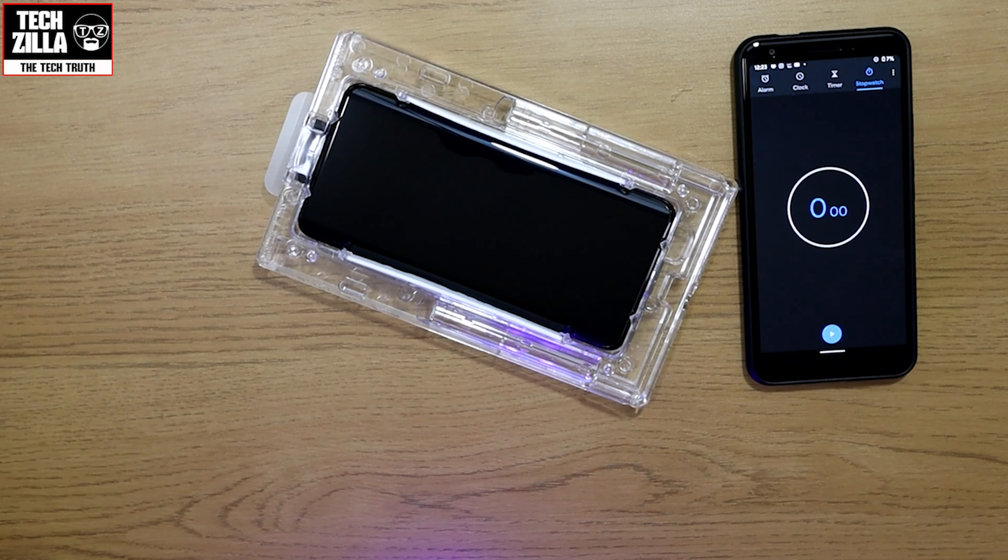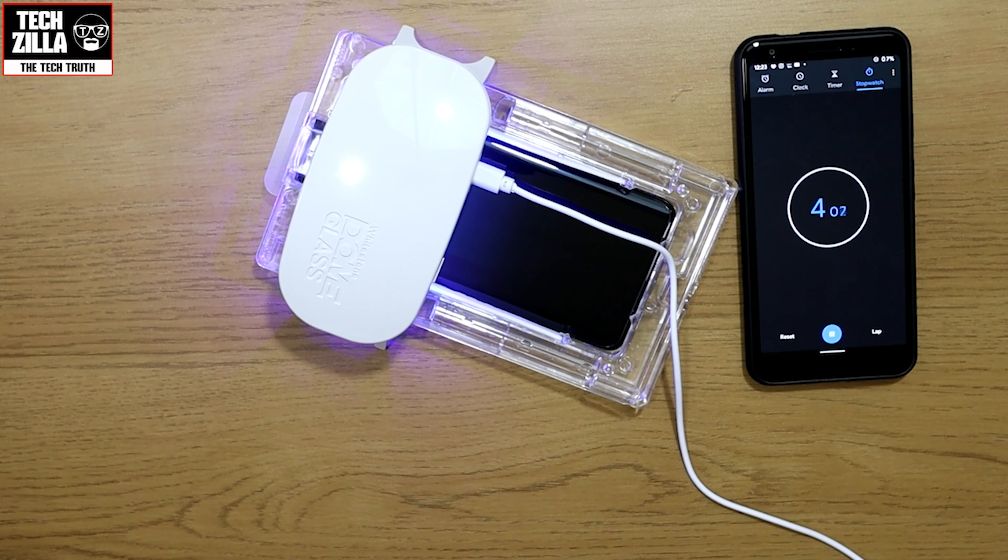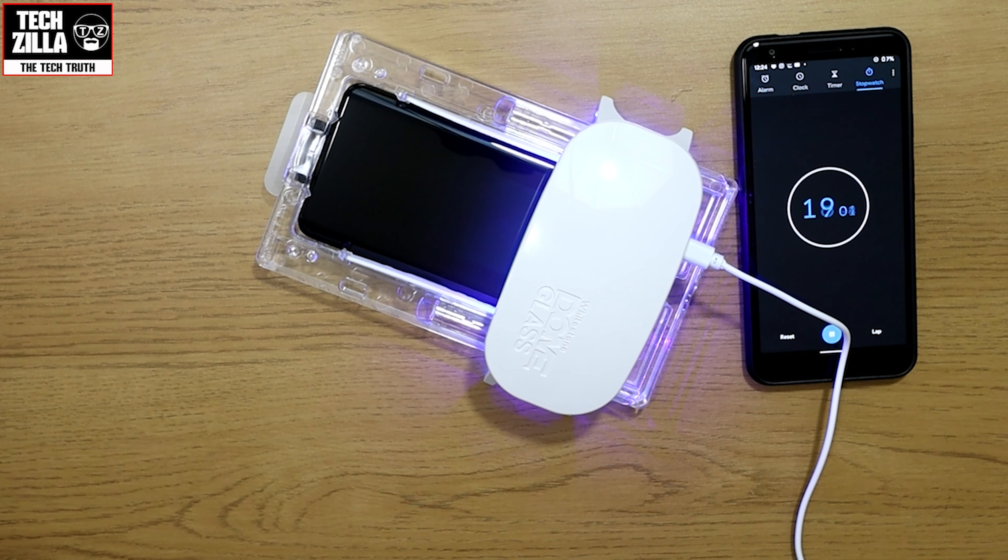We are nearly there. Now using the UV lamp, use it to cure the glue on the top half of the screen for 15 seconds only — do not go beyond this time. Repeat this step with the bottom half of the screen, again for 15 seconds.